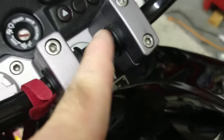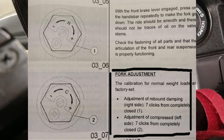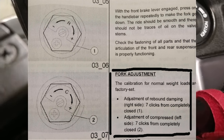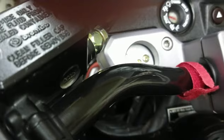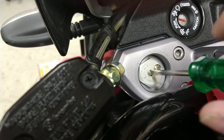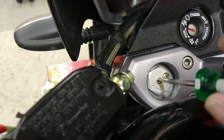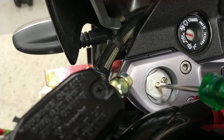In the book, the compression is on the left side — the clutch side — and the rebound dampening is on the right side. According to the book, the normal factory setting is seven clicks from the completely closed position. You need to read your book on that because sometimes they go from completely closed to completely open. All you have to do is pull this cap out. Seven clicks would be the factory position — I counted to seven and thought that was a little stiff for me. It's got a total of 23, so I'm going to go about halfway — to 12. I'll do the same thing on the other side.